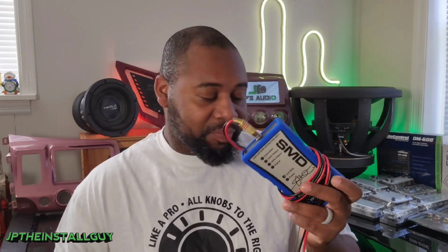It's kind of hard to tell what number you're actually on, which is why you need something to let you know when you're not clipping. Now, some amplifiers do have a clip indicator on them. It's probably a good way to start, but you definitely need a testing tool to double check and make sure that your signal is going to be clean.